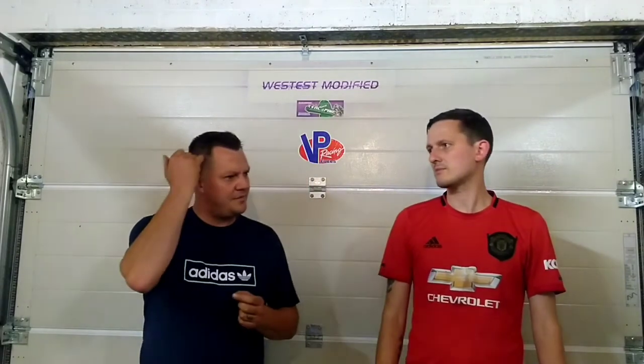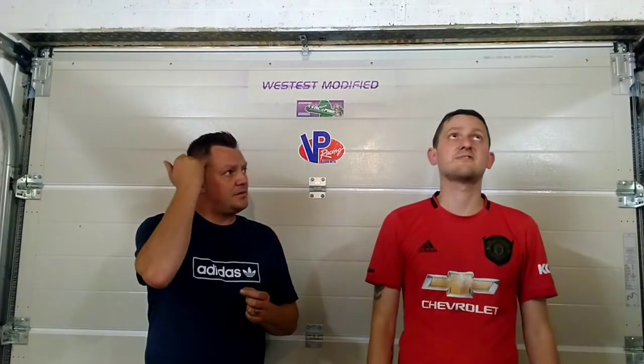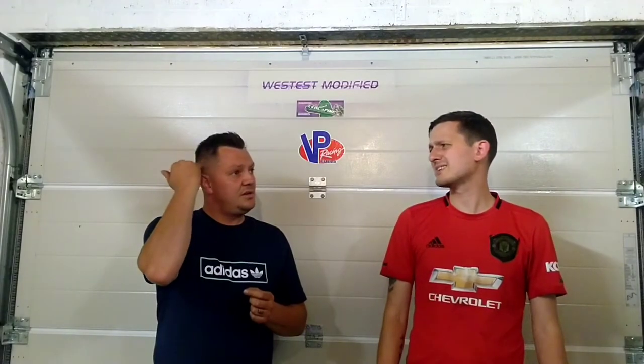What size? M6, but I think they were M6 by 15, off the top of my head. Yeah, they were like 14 mil, or just over 13 mil, on the outside diameter of the body. So what we've done is use a step drill to modify the holes. So you can no longer put it back to original, but that's not going to happen. That's what sometimes happens with modified stuff, innit? Anyway, it does look good. So we fitted all that.